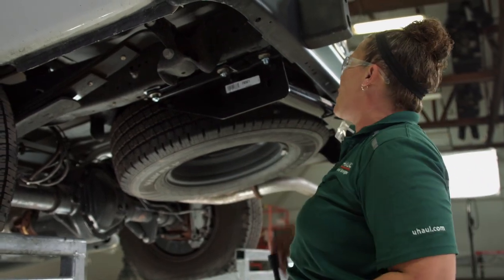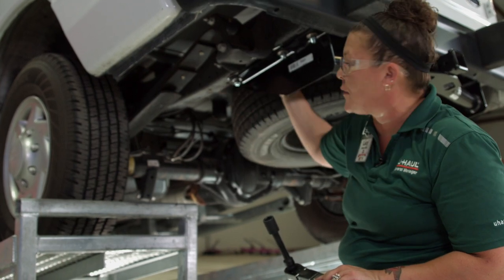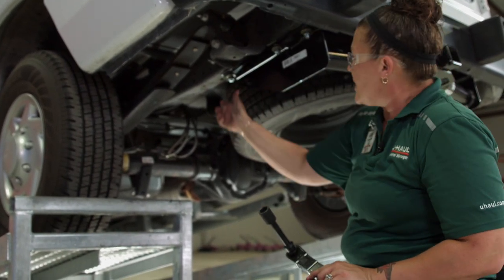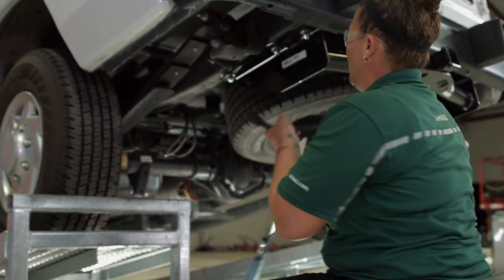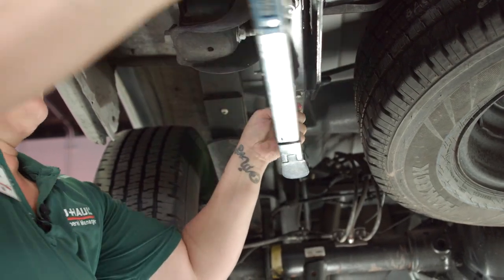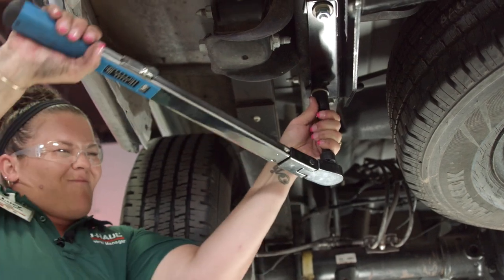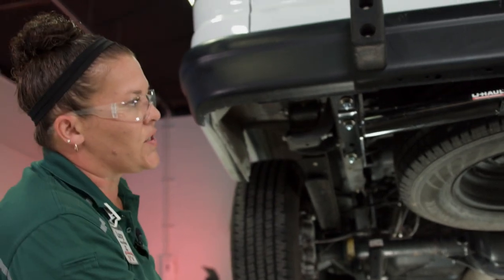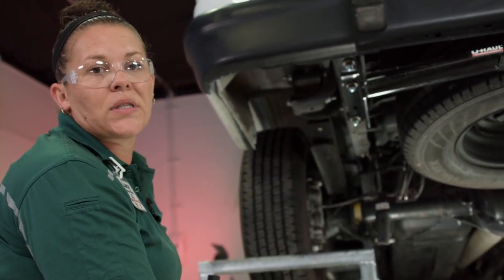Heard that — that one's good to go. And because the rear bolt is a locking carriage bolt, which you'll notice from your instructions on your hardware, we don't need to worry about it spinning because it's locked in place right now with the spacers we've put in. Pushing is always better than pulling if possible. Already done. So we'll continue the same process on the passenger side until all of them have been torqued at 75 foot-pounds.